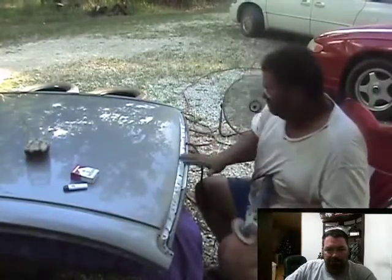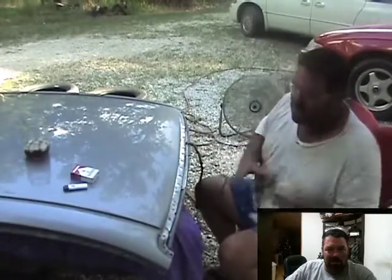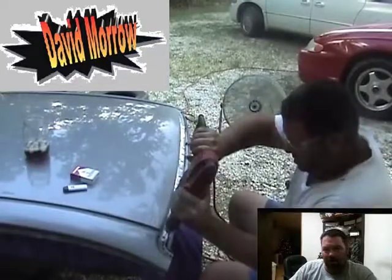Now that we've got that cleaned up you can see where all the spot welds are perfectly. You can't do the area in between until you get the top off, but you're going to have to do the other side as well. It's harder to see these spot welds down here for some reason, but sanding worked out really well. You'll find out that you missed a few or there's metal overlapping others when you're using the cutters.